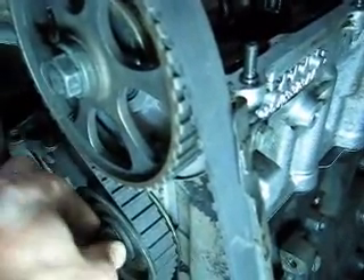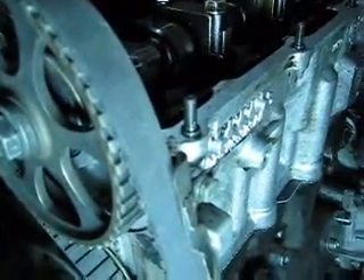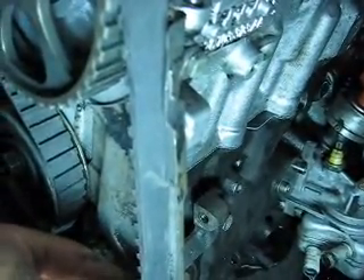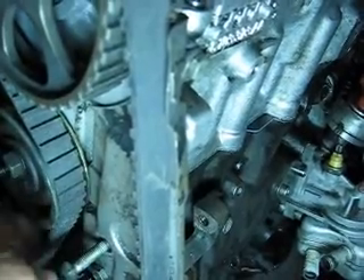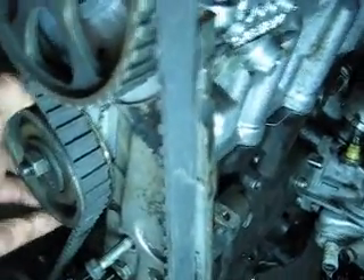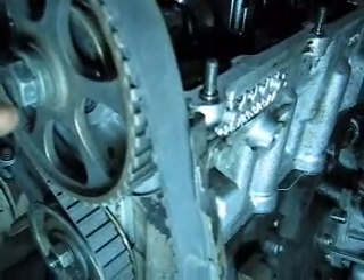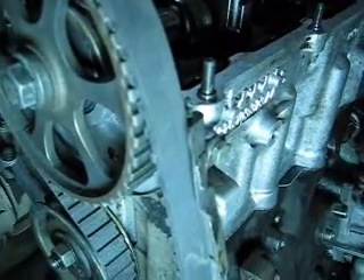These don't need to be really, really tight. Some people are obsessed with getting this very very tight — you don't want that. You want it obviously tight so it doesn't rattle all over the place, but you need to think that when the engine starts all the metal is going to dilate, and so these sprockets will actually finish up being further away from each other, just ever so slightly. And if you've got it tight when it's cold, when it's warm it'll be even tighter.